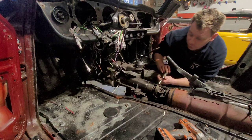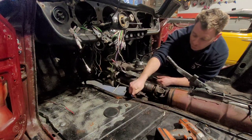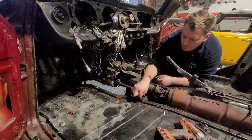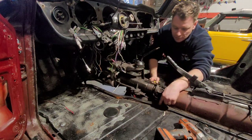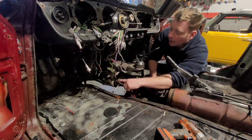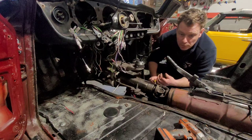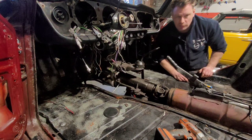If I was doing it again, I'd probably recommend putting the rubber strip on upside down because you have a flatter surface — it doesn't make a difference. It's shaped to go over the edge but it never actually fits perfectly. You'll still get the same seal. Wherever you have a bend, if you're starting from one end and going left put a V shape on this side; if turning right put a V shape on the inside. It will never sit absolutely perfect — in an ideal world you should have just got these moulded to shape, because all the floor pans are the same shape anyway. You can use silicone and a clamp if you want, but you just want to hold it enough in position to get the cover on.